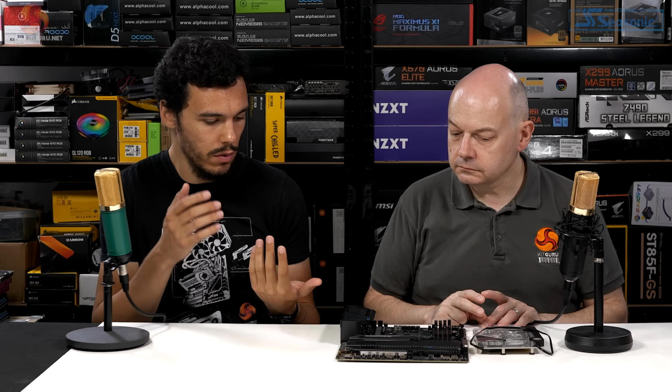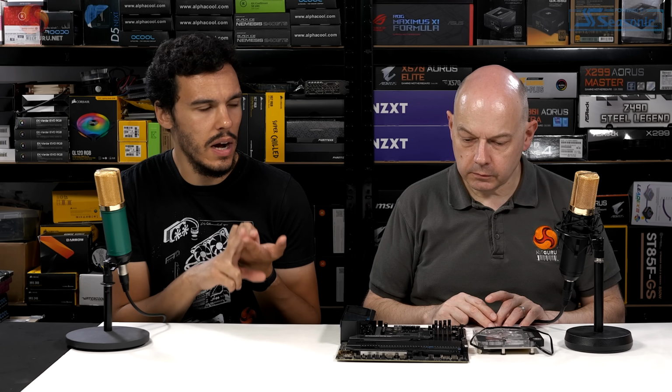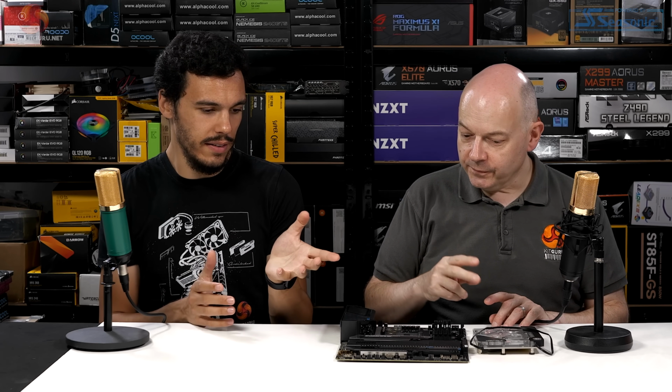And I say generally because you do have the Gigabyte one, which is fanless on the chipset, the X570 Extreme. Yep. And also £700 at launch. Many pounds, I know that much. Yeah, we have used that. It's a nice board. I think James used it in a build recently too. And you did have the Crosshair 8 Dark Hero from Asus, which didn't have the X570S. Basically, there's two models of X570 motherboards passively cooled, until this batch of X570S boards come.